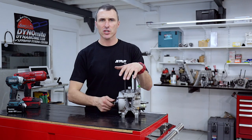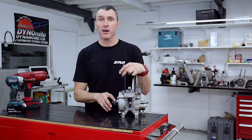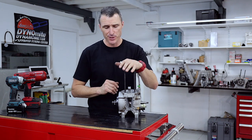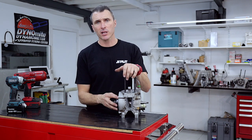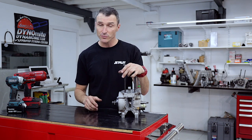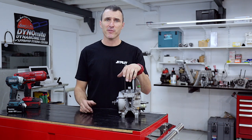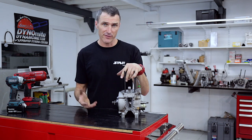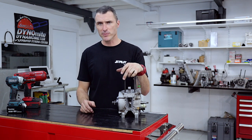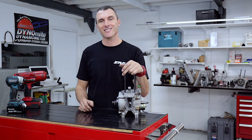So there you have it — that is the X30 clutch maintenance program all taken care of. Check those out regularly and regrease your bearings on the regular. If you're degreasing your engine and jet washing at the end of your race meeting, make sure you remove the clutch drum, regrease and clean the bearing, and then reassemble it. It's pretty easy to do especially if the engine's off the car. If you like the video please consider subscribing and turning on the notifications — it's really important to us. Give us a thumbs up, leave a comment below if you have a suggestion for a video, and follow us on Instagram and Facebook at Power Republic, or go to our website at www.powerrepublic.com.au and grab yourself a t-shirt, a hat, or a brand new X30 race engine. Thanks for watching, see you in the next video.